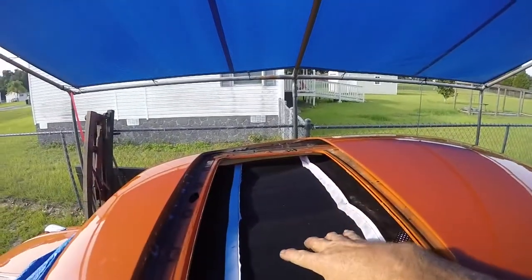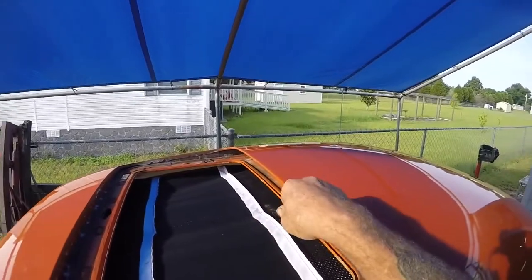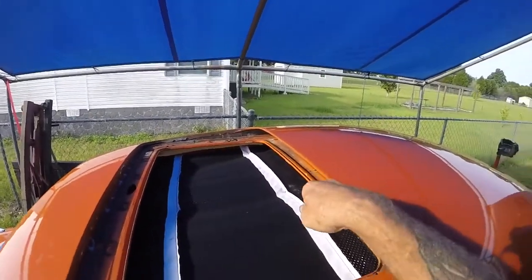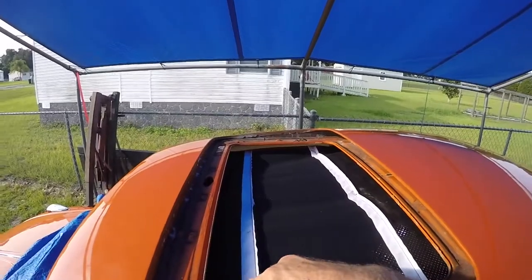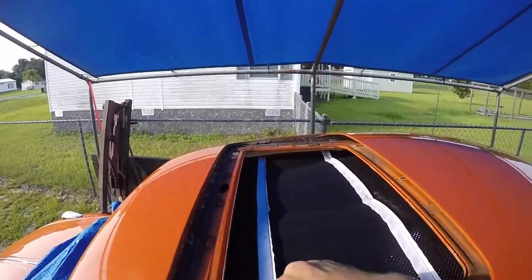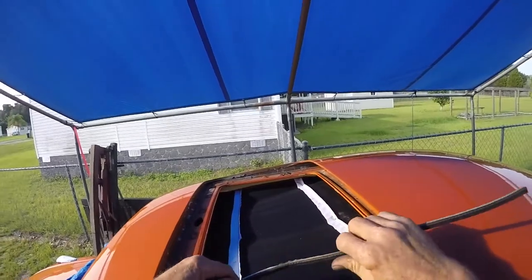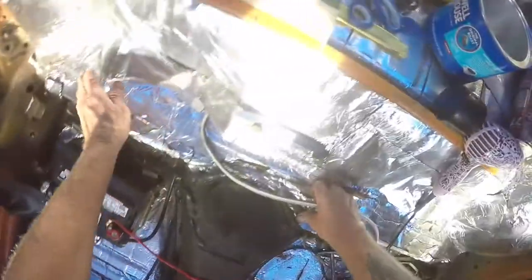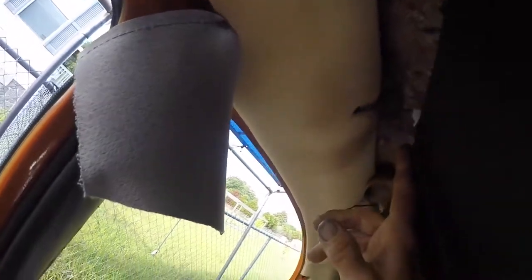All right guys, I'm back on the headliner. Remember when I said this wasn't actually the headliner for a sunroof? The difference is they wouldn't put these bows in it, but it worked out the way I wanted — I wanted this stitch to be well past where I fold it over. I'll just trim the fabric off so I don't have a lot over here. I also hung up the headliner and had a heck of a time figuring out where the bows went because there are some springs missing. I actually made replacement bows out of strong baling wire.